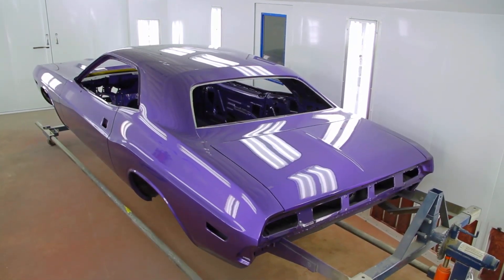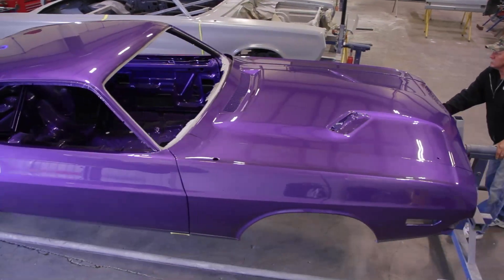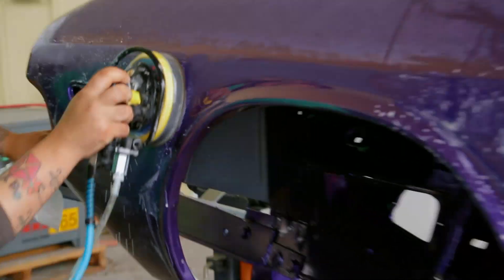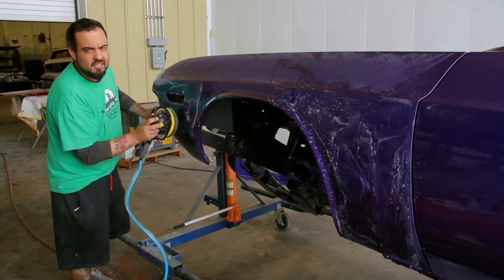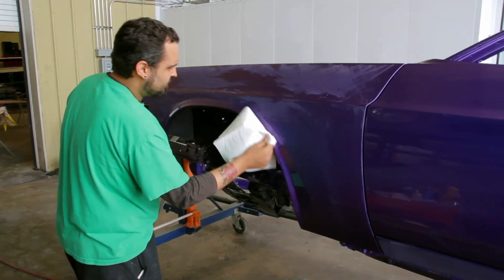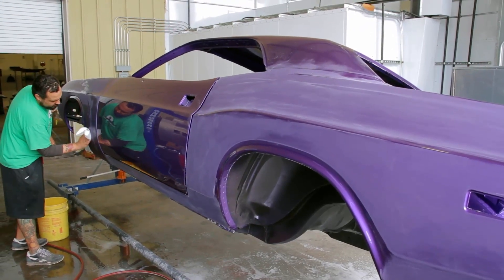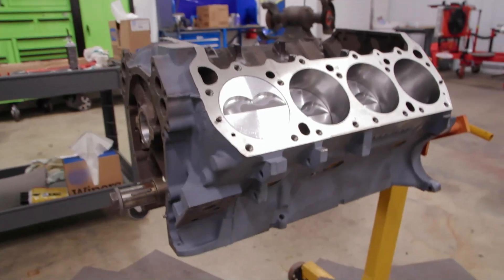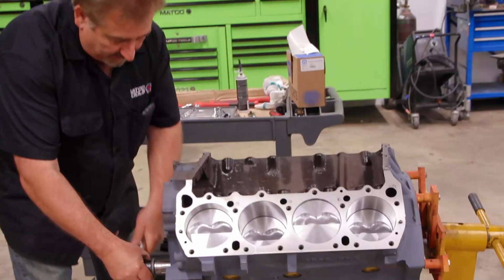In the case of the Challenger, once it's all painted and it has an opportunity to cure for seven days — that's my requirement here — it's ready for the wet sanding and the buffing. That's just a fairly simple process, but it's labor-intensive. You have to do a wet sanding buff. I know Mark will come out and say the paint job was perfect, but there's still orange peel, still little dirt nibs — that's an absolute must to get these cars looking to show quality. Factory didn't do any buffing; it's a mass-produce, spray-it-and-be-done situation, and they're still doing it that way today.